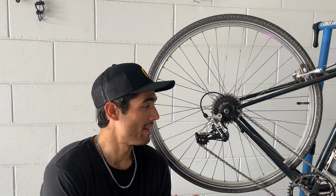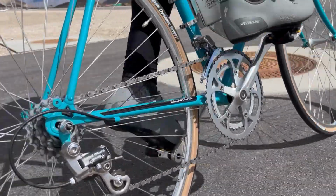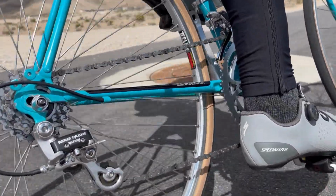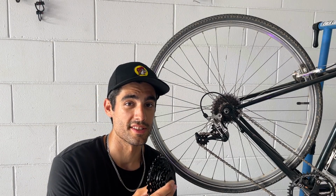My rear derailleur is a SRAM Rival 1X, and I have that set up where it works perfectly fine. Since it's friction mode, I don't have indexing, but just because I don't have indexing doesn't mean I can't tell if the shifting is good or not, because I have used Suntour freewheels that didn't have the design that Shimano puts in their cassettes. So I know what fair friction shifting feels like and what good friction shifting feels like. With this cassette, I see that Shimano has implemented that design as well, so I have a lot of confidence that it's going to shift pretty nice.